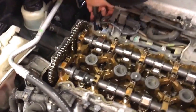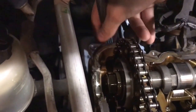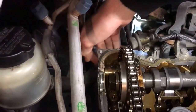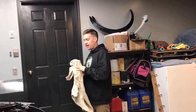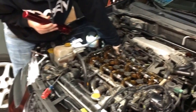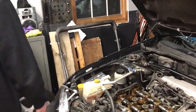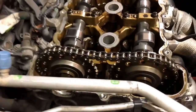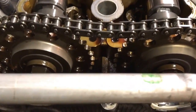So what are we doing over here? We're taking off the tensioner - it's two 10mm bolts and you're gonna get them loose. We should probably zip tie these sprockets on there just in case - not that it's gonna jump but I want to make sure. We're gonna zip tie these sprockets together so they don't move from top dead center while we're moving the tensioner. It's really about not jumping a tooth.